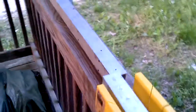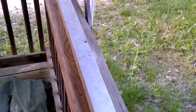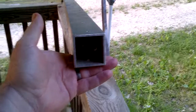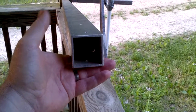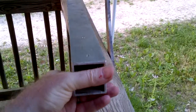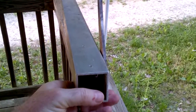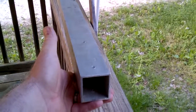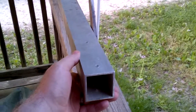I've also got the rear axle drilled to accept the titanium tubing — drilled in both ends. I've got my brother-in-law working on wooden blocks to go in there with a one-inch hole drilled in the center. I'll press fit the wooden blocks in, slide the axle tube in at the proper length, and then drill through for a couple of 3/16-inch bolts.